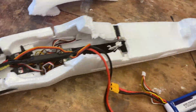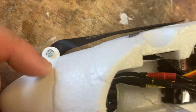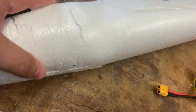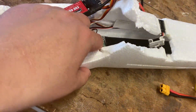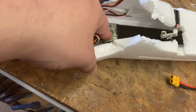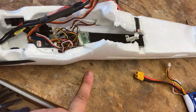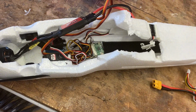Anyway, in terms of repairing this, what am I going to do? Well, I'm fairly lucky on this side. There's a crease here, but otherwise that's about it, and there's a crack across there. So I'm going to have to take everything out of this front section, because the problem is where this is squished together instead of snapping. I'm going to take everything out of here: servos, motor, speed controller, S-bus decoder. It could be the S-bus decoder that's at fault, but if I used these before, they'd been fine. And also the fact that I then had an issue with the Drift, which just has a Nano SE, so not a diversity, a single antenna going into a Maytech, whatever it is. Yeah, it's a bit weird.